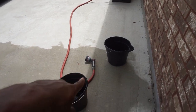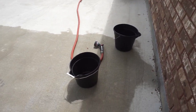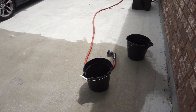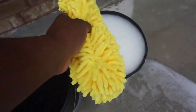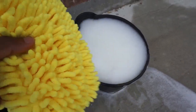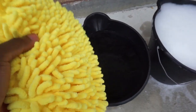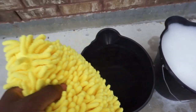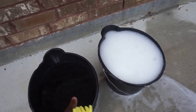I have my two buckets out because I'm gonna be using the two-bucket wash method, which is pretty simple. For those that don't know, I'm gonna show you. All you do is put the microfiber wash mitt in the soapy bucket, wash your car, and whenever it's time to rinse, dip it in the rinse bucket. When you go to wring it out, make sure you wring it out onto the ground so you don't contaminate either bucket.